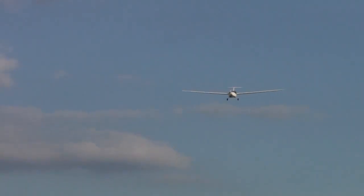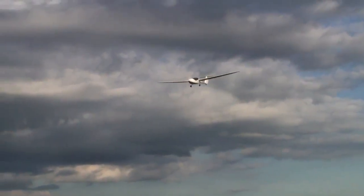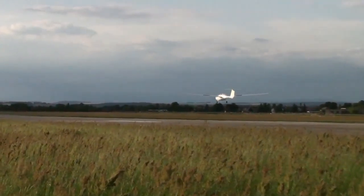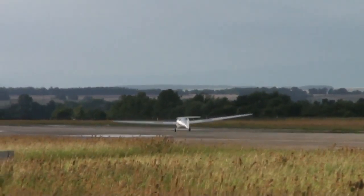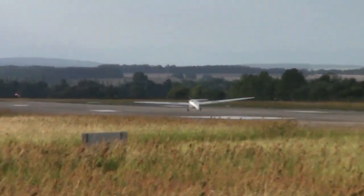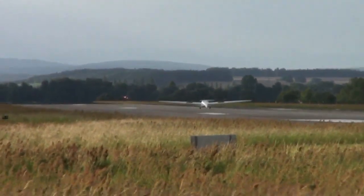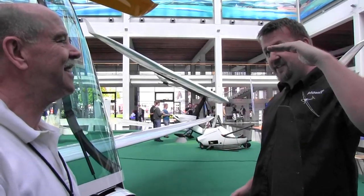It's nice to have all this weight up in front of the occupants — this is 110 pounds of battery weight. During the next two weeks, we want to keep flying with this to be sure that all our calculations are right and that our expectations for increased endurance are correct. One idea we want to test: the adjustable propeller allows us to try recharging with windmilling — regenerative power. We want to go below the cloud base, keep windmilling the prop, and try to charge the battery back up.